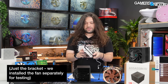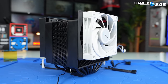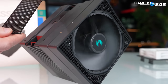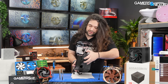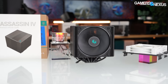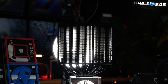DeepCool includes a fan bracket that you can attach — as far as we can tell — any other 120mm fan to, with standard hole spacing. The metal mesh top piece is for looks and can be easily removed to reveal that 140mm central fan. The central fan pulls out with some clips, but that creates some compatibility issues we'll talk about later. The cooler looks large but it's a bulked-up dual tower design with a lot of plastic and mesh metal embellishments.